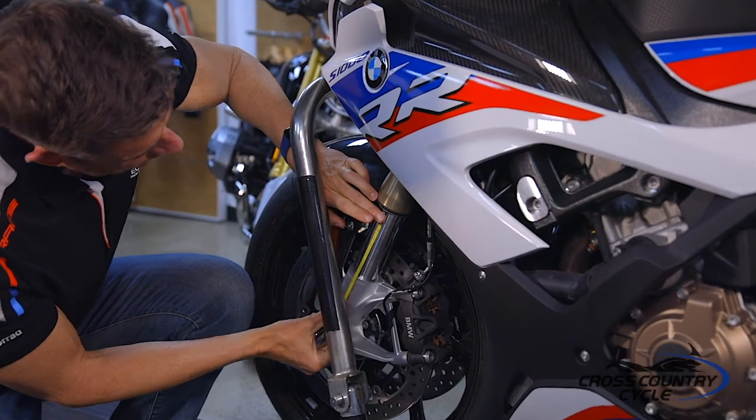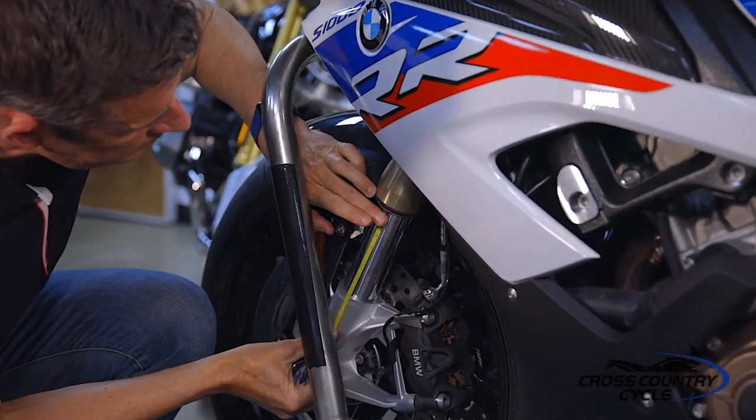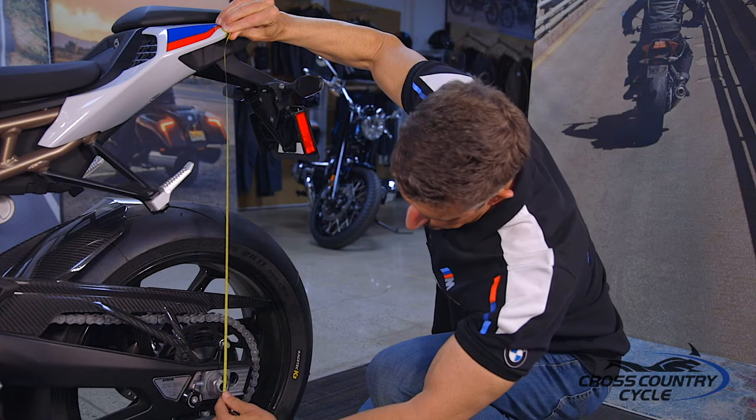There is no perfect sag number that will give you perfect chassis balance for every track or road condition. The process of setting rider sag is to give you a balanced chassis as a starting point. You will then work toward getting the proper support that works for you on the track or road and at the speed you'll be riding. If you ask your local pro racer what sag numbers he's running, he'll probably say he has no idea — his bike has been set up specific to the track he's riding, which leads us to the tires.